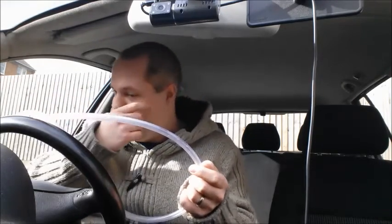One of the reasons is obviously to make sure you can see the diesel purge going through and you haven't got any air going into the engine. Another quite useful thing, especially on a PD engine such as this one, is it has a lift pump in the tank and also a pump on the engine that brings the fuel up. Now, it can happen where the lift pump on the fuel tank will break, but the pump on the engine will still have enough power to draw the fuel up from the fuel tank. So if you ever run out and then refill it, there'll be air in your system and it won't have enough power, but you'll only find out when you've run out, so you'll be up Ship Street.